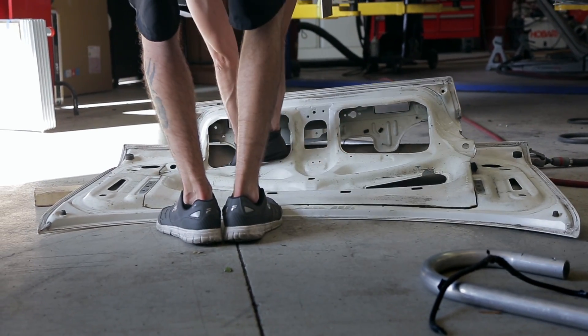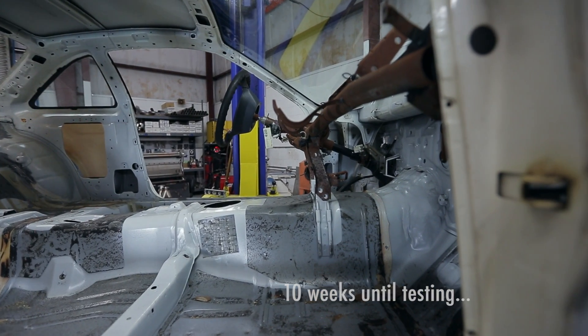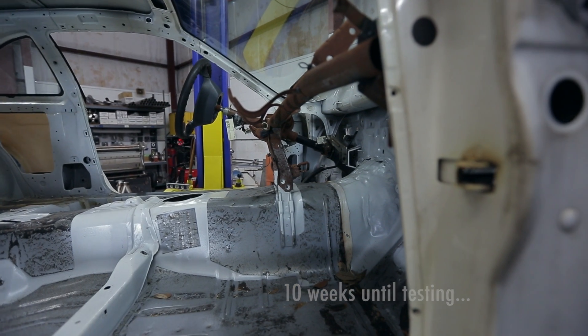I know the car was smashed pretty good in the back. The trunk, everything was just kind of all over the place, so I'd invest the money in it and have it taken to a frame shop. Everything's within factory tolerance for the rear subframe mounts forward, so we're good to go.